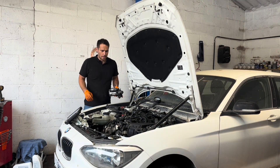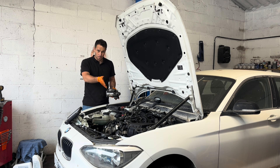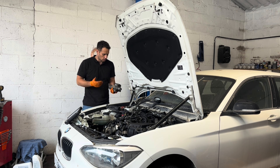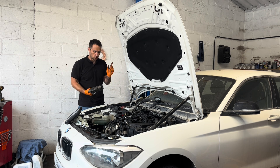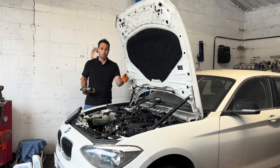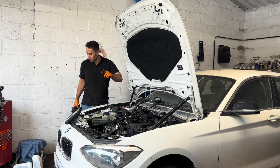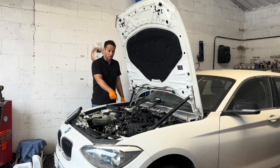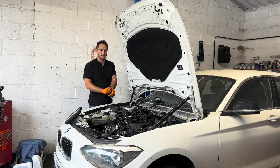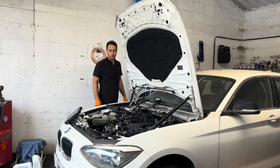We don't have a good start — something is wrong. I replaced the starter; it is very, very hot even now to the touch, and it smells. I'm hoping it's only a bad starter. This car sat in the water longer than I thought, and it's just a bad starter. So now I've put a replacement one in — let's try again, and hopefully this time we have better luck.